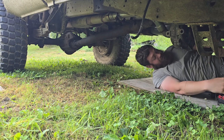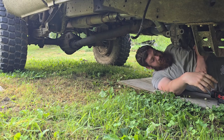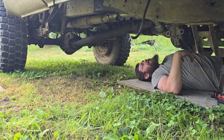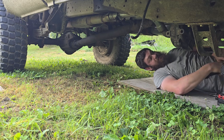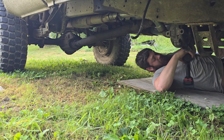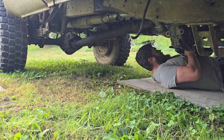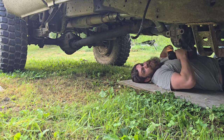I'm gonna unplug my O2 sensors and get the three bolts off my header flange, and then fight with these clamps to come out. They had these nice and tight, but they will go back together with anti-seize on everything.